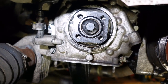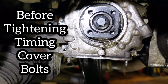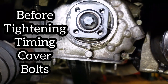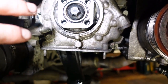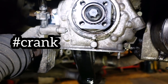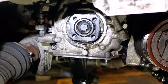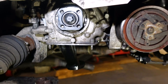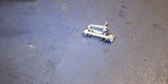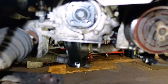It's also a good idea to give this crank bolt a bit of a tighten - not the full torque, not the 230 or 240 Newton meters. Give it a bit of a tighten to seat it - you'll feel it sort of pushing against the cam wheel on the chain, so it seats it. I was happy enough to do that with my ordinary ratchet just by feel, because I have the flywheel holding tool in. I've now taken it out because I've fully torqued it.